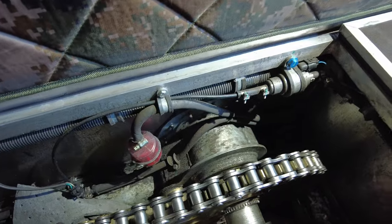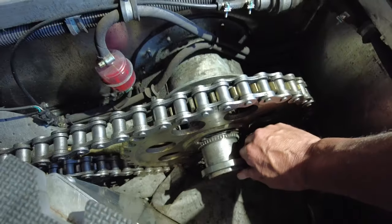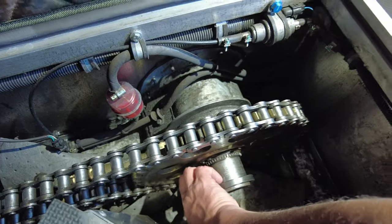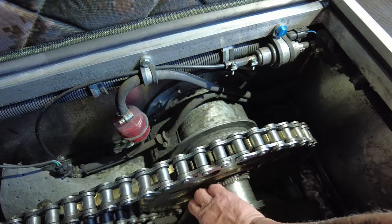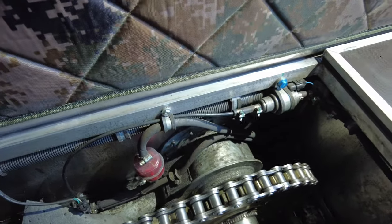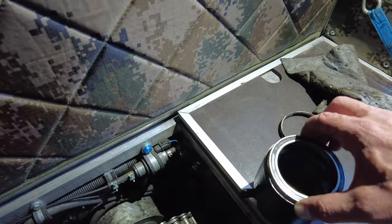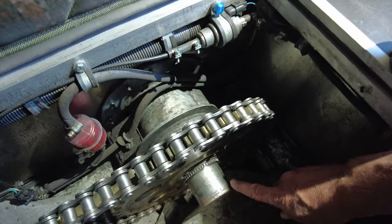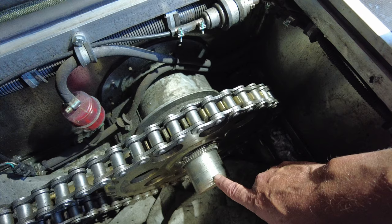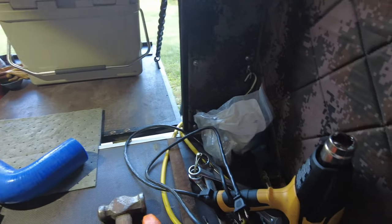The challenge I'm faced with is this bearing will only go on so far and I can't get it on any farther. I can't really pound on it with something. The outside bearing - I'm very confident that's going to fit on there no problem. But I have sanded. This outside bearing just doesn't really hold in there that good - it doesn't have to be really pressed in, which is the same as before too. So I can only push that on this far. What I'm going to do is take that dry ice and put it on here - hopefully it's going to shrink it down a little bit. Additionally, I also have a heat gun to try as a last resort on that bearing.